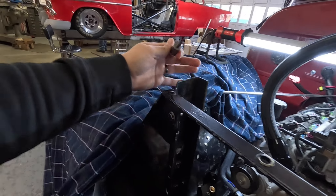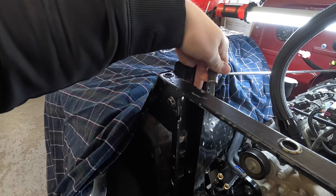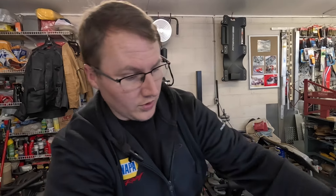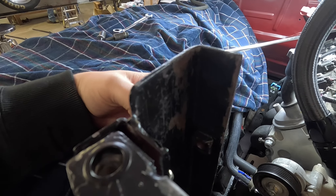Like we told you in the previous episodes, we're working on all the plumbing. We ended up having to space the radiator forward about an inch, so we have some metal spacers that go in between the radiator and the actual radiator cradle, right here into what used to be the stock threaded inserts. That's what's getting it spaced out toward the front of the truck to give clearance for all our coolant lines.